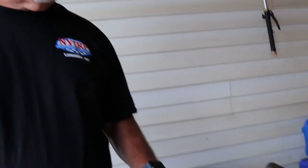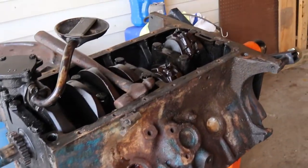For now, I want to show you why I am doing this — why I particularly got this motor. I am a big Ford guy. This is a big block Ford FE motor. FE stands for Ford Edsel — that was their design in 1958. It was used for a decade, up until '68, '69 — that was the last year for this motor, except in some trucks. So this motor is in excellent condition. I am going to do further research to find out if those are original bearings, if everything is original, to find out the possibility this might be a very low mileage motor, because there are no signs of extensive wear or carbon buildup — stuff you'd normally expect to see in a motor this old, what, 40 some years.